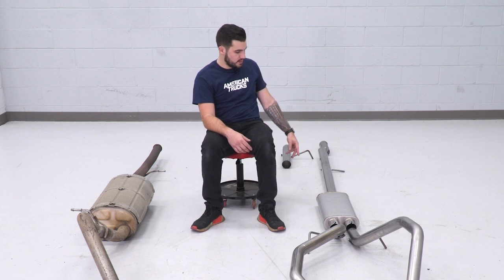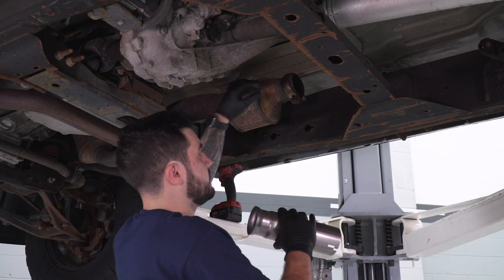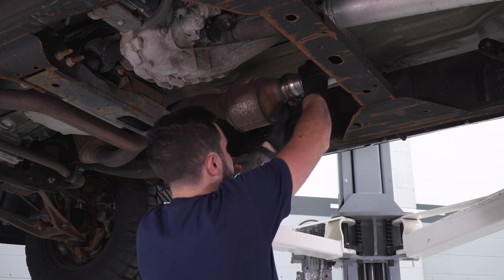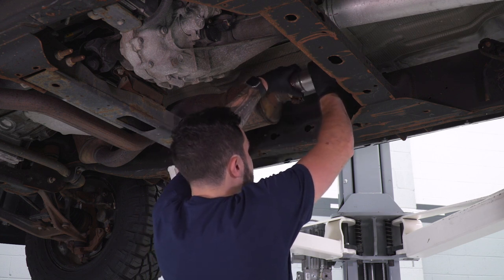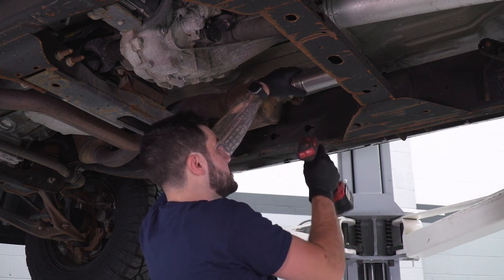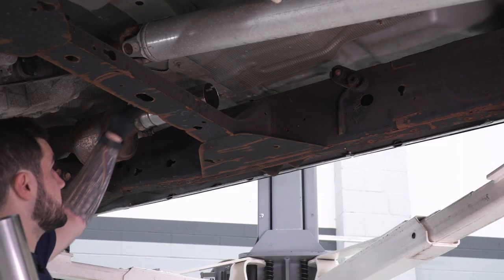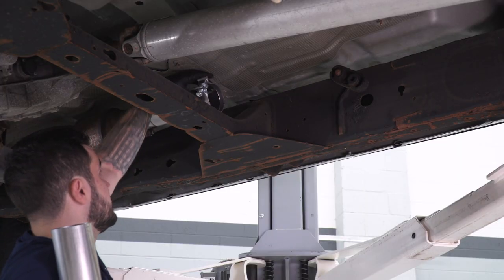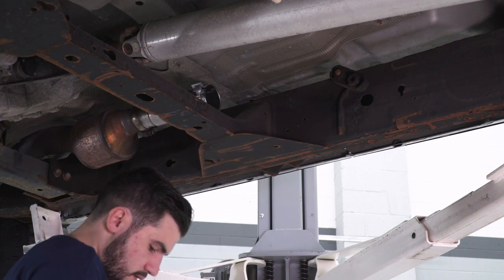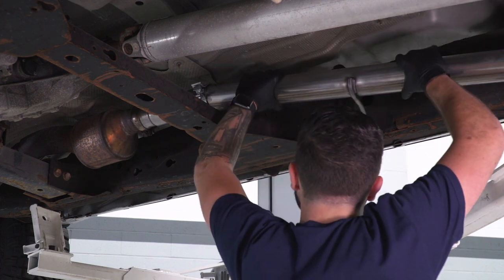Let's get to the install. We're gonna start with the adapter pipe at the front, move on to the extension pipe — you're gonna use that depending on your cab size and bed length. To install our adapter pipe, we're using our factory clamp which we still have on our cat. You're basically just gonna line that guy up, make sure they seat on top of each other perfectly, and then align that clamp so it's right in between the both of them. Grab your 13 socket — I'm not gonna over-tighten this because you wanna leave room for adjustment to make sure it's straight. Now put a clamp over that adapter pipe, make sure that seats all the way back. Grab your extension pipe, feed that over the crossmember into that pipe, and line it up to the hanger on the frame.